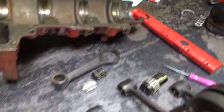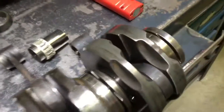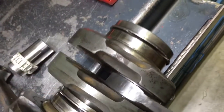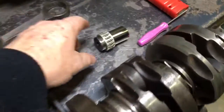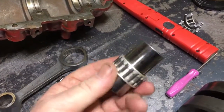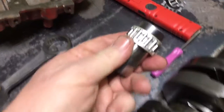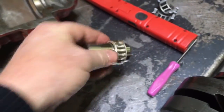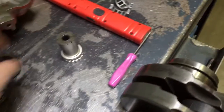There are some better cages out there being made today, but you've got to be careful, because here's a good running engine that was ready to die. You can see it's cracked all the way around. It should look like this — this one's not cracked. But with age and any detonation — and if some water gets in there — that's definitely going to cause an issue. What we're doing to combat these cage problems: I have contracted a manufacturer. We're going with a modern bearing — a modern snowmobile/jet ski two-stroke bearing — lots of rollers, lightweight, doesn't lock up or cause issues at high RPM.